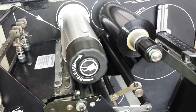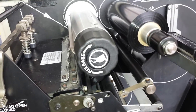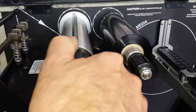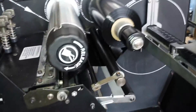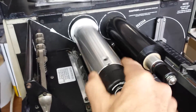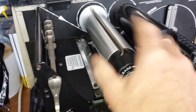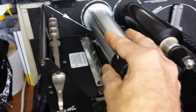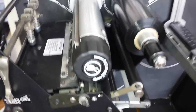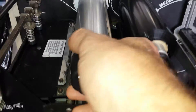This video illustrates how to adjust the clutch that provides tension for the ribbon take-up spindle on a Zebra XI series. If you're getting a symptom where the ribbon coming over the top is not getting pulled up, and it's not gathering the ribbon with enough tension and keeping this section of the ribbon taut, you may have to get into the inside of the spindle.